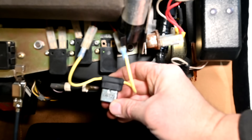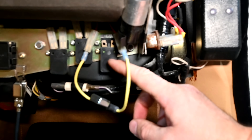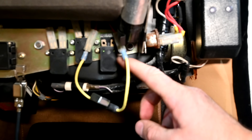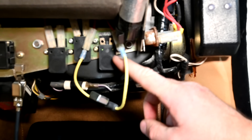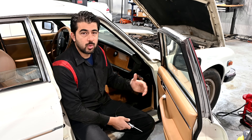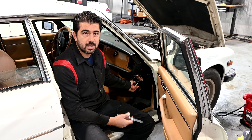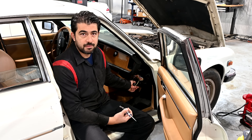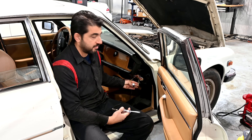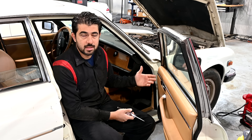Here's what they did: since this fuse blew when that short happened, they wired in this aftermarket fuse right here. This is a 30 amp fuse. I'm not sure about the factory fuse, though it's possible it's also a 30 amp since two power windows are running off of it. Whoever was trying to fix this problem figured out the fuse was blown and wired in this aftermarket fuse — and that's exactly what you don't want to simply do.